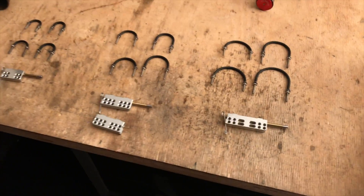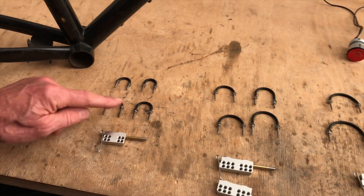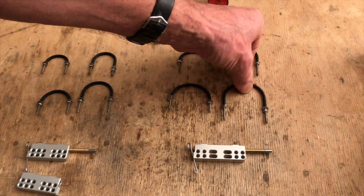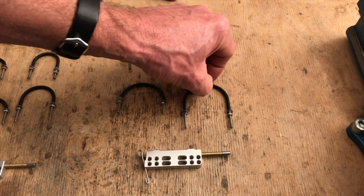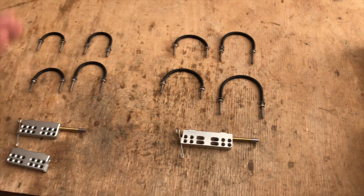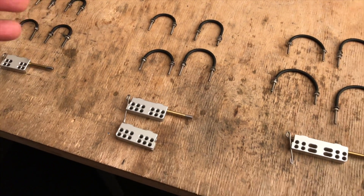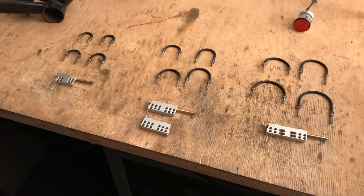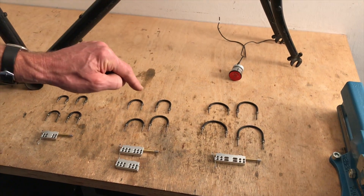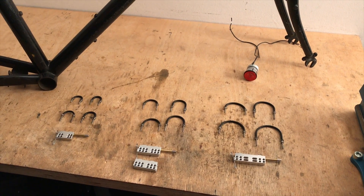In general, most tubular steel frames have the middle sizes. The extra-large size is for really thick suspension forks and special carbon constructions. Aluminium frames are preferably in the middle range. But it doesn't help — you have to determine the diameters in any case. You need to determine whether round or oval, check the table, and then pick the appropriate bracket and matching holder. This results rather clearly from the table.